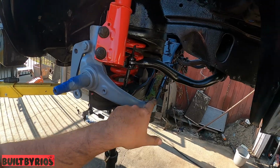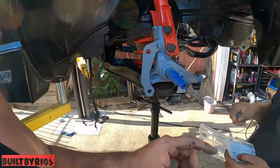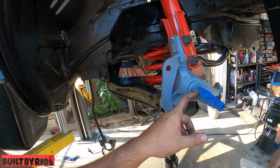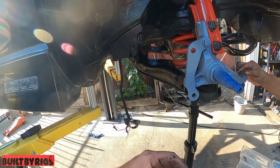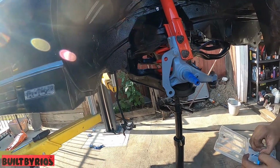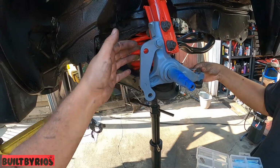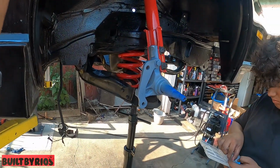But all he's going to do right now is put in pins, lock them in. I'm going to change the battery and bring it back, because we have to do all new bearings for the hub. We're using new bearings here. So we're going to put on new bearings for the hub and the caliper. We're going to see if it needs shimming. And that's about it. But let me bring in a new battery.